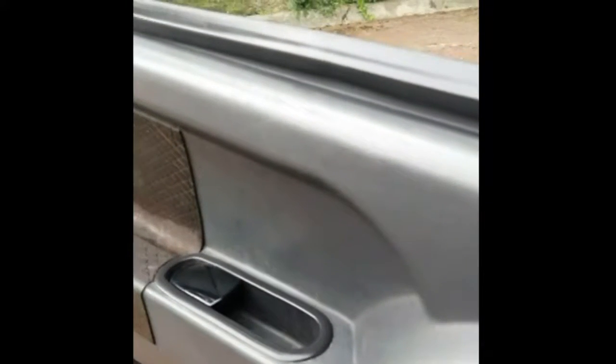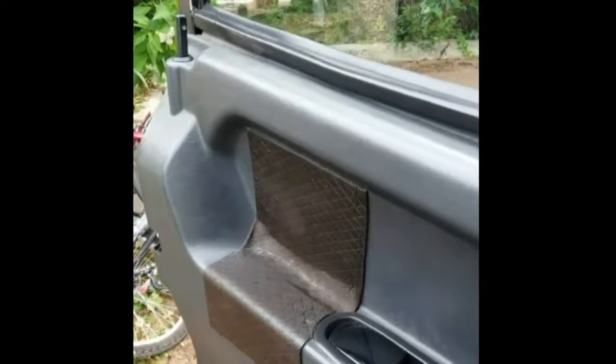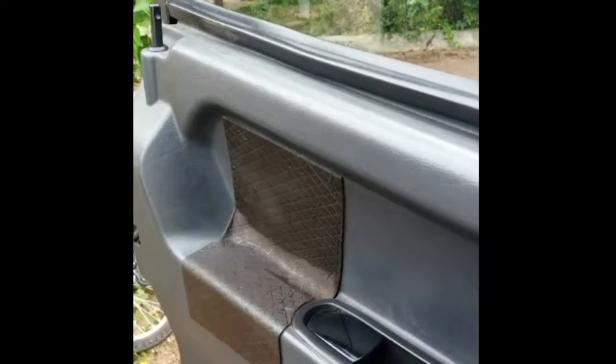There's a little problem with this panel - it's a bit loose, mainly at the bottom. You can see it moves quite a bit. Unfortunately, Aixam, when they built these sans permis vehicles, don't tend to use a lot of bolts - they tend to use a lot of glue. The doors are basically a metal frame inside the panel, and the inside panel and the outside panel are glued together. So I've got to find some way of re-glueing the various bits around there. I don't see the point in getting a new seal - it just needs reattaching, and once the door's secured it should be okay.